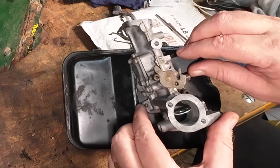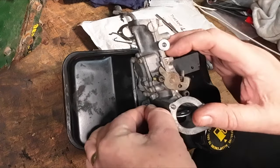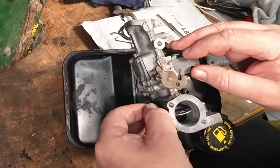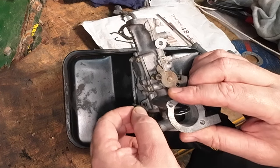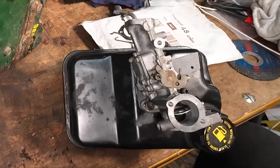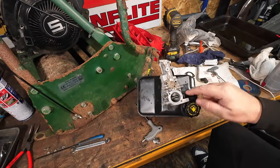It's only because it's probably a copy gasket — that's all it is. It wants to go about there, that's where it wants to go. Might be a bit of forcing going on just to make it sit down, but you can see what I'm trying to do. There it goes. Let me just grab the correct Torx bit — that's the wrong size Torx bit. Get those two screwed down and that one in the centre screwed down. So my carburetor's now been screwed down — three screws, all now done.